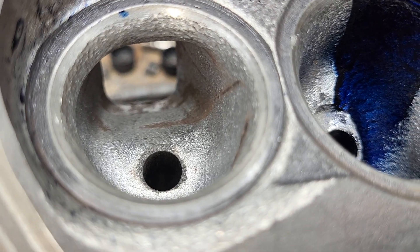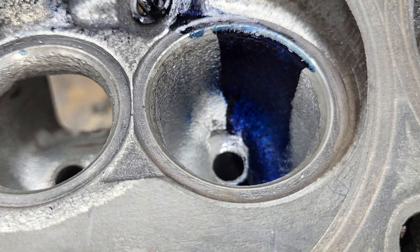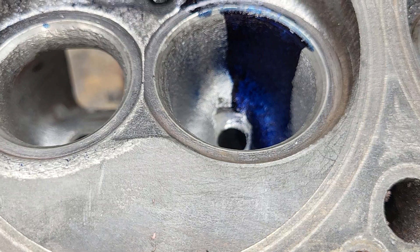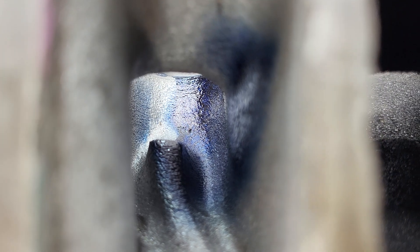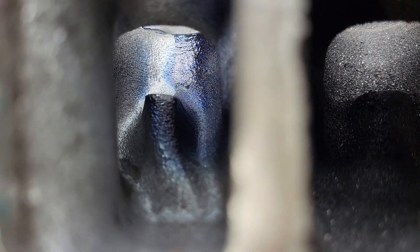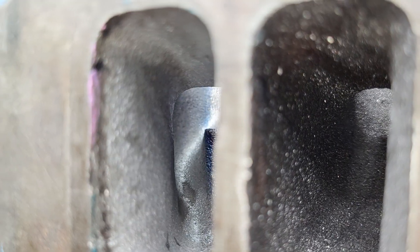I got quite a bit of work on the roof and took a lot of the bulge out. I didn't use any sonic at all to port these out. The port has been opened up a lot on either side of the bolt. My rule of thumb for porting is you can take a hundred thousandths off everywhere in the port and not worry about breaking through. If you don't have a sonic, that's probably a good amount to use.